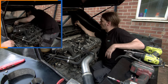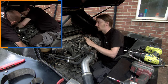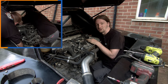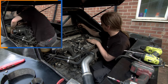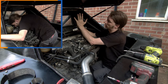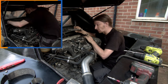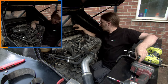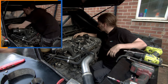The big win we got out of this was relocating our ECU harness connectors. This isn't VW's fault — they didn't mean to put the ECU on the back of the radiator. Their loom obviously went somewhere else. But the way it all came together for us was that the connectors ended up in front of the engine near the firewall. We could mount the ECU on the back of the firewall, but it would be quite tricky to get to, there'd be a lot of engine heat, and not really a lot of air circulation. So instead, we've relocated these connectors up into this top right corner. That means we can use a mounting bracket that Aid made — the ECU slot-loads into it, and then a screw on the top just pinches it into place, with connectors on the bottom. It's going to be up in this corner somewhere, probably just welded onto the body. Having it up here gets it away from engine bay heat and gives a lot easier access in case we blow it up again, which I'm hoping we don't.